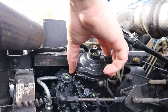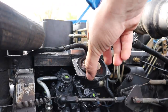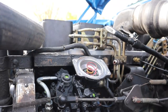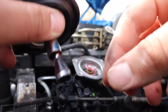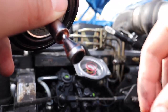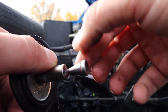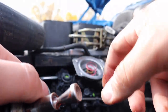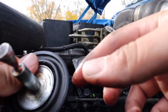I'm going to carefully lift this up — this is just kind of the top plate. Just set that aside and don't lose anything. Now take this off carefully without ripping it because if you rip it you're in some trouble. There's something gross in here — I'm not sure if it's gelled fuel or just grease. This pump is new by the way. When I bought the truck it had a horrible fuel leak and they put a brand new OEM pump in. I should have had them do the modifications while they were in there but I didn't think about it at the time.